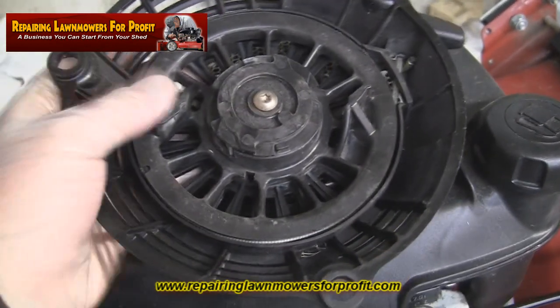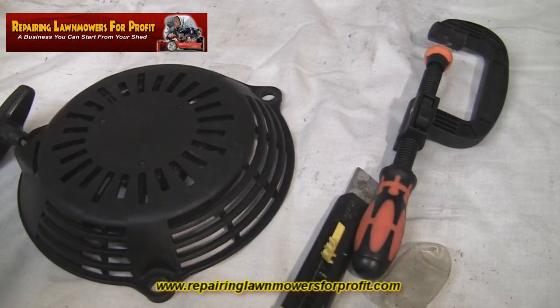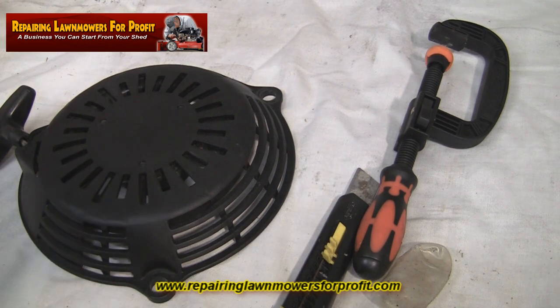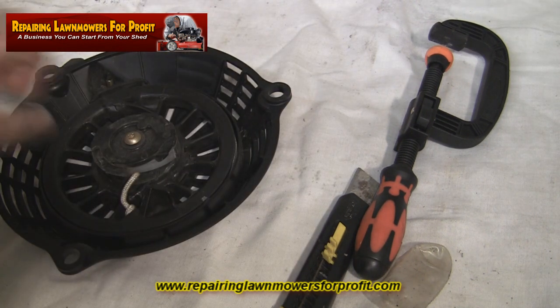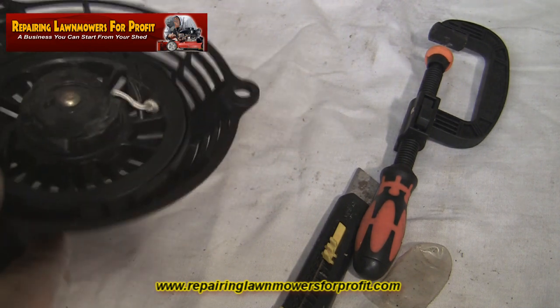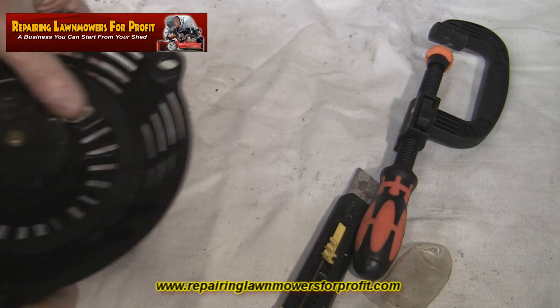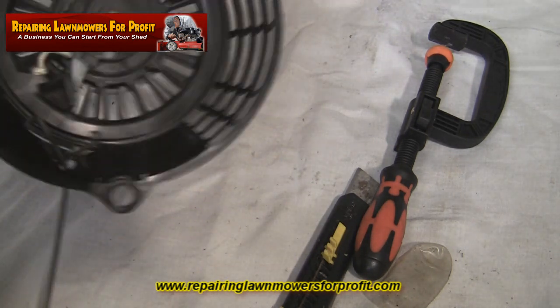As you can see it comes off. I'll show you how to repair the rope. Now with the starter recoil removed, if we turn it upside down you can see the string here — the pull cord, if you like — that's been pulled through. To replace that if it's snapped off and it's still left in here, basically just take it against the tension and move it away as far as you can.